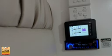That backlights the screen. Now we're talking about storage before. If you want to put it into storage, press the battery button up here. So that's just completely shut down your 12 volt operating system. Now you'll notice your air conditioner is still running and the microwave because they're on 240 volt power on the mains. Now you turn that off when it's in storage.